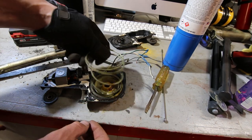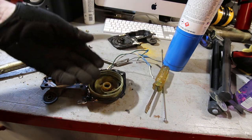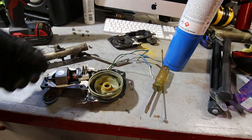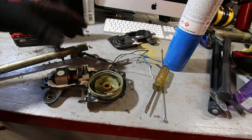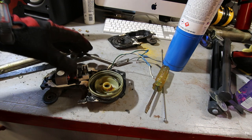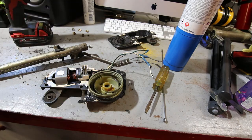It's all spooled up, so that was in the pulled down position. I do have a length measurement that I'm gonna go for. It's like 36 and a half inches, if I recall. So I'll do that, and when we're in the car, we'll fully retract it and everything, and then hopefully when we fire up the motor by turning the radio on, it's gonna shoot that antenna up, and we'll have a good up and down action.